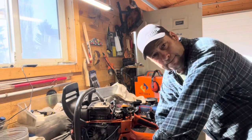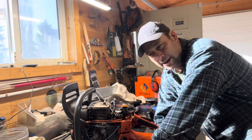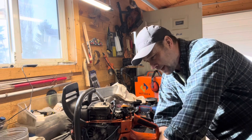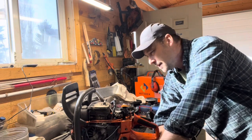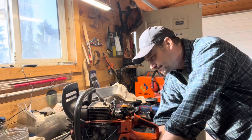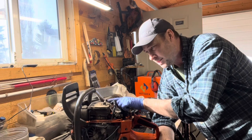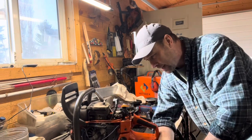Morning, it's Jim. It's Thursday, around April the 11th. I've been kind of down with something all week — I think I actually ended up not wearing my respirator when I was doing a bunch of grinding and welding last week. Anyway, I got a 390 back in from a guy that was using it out at a coal port where they load coal from trains onto ships, and all that coal dust coats all the vegetation out there in northern BC on the coast. His saw quit running, so I'm checking it over. First thing I found was the little wire coil over the spark plug from the cap is broken off, so that definitely has an impact.